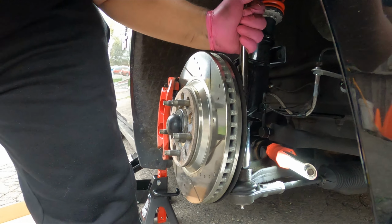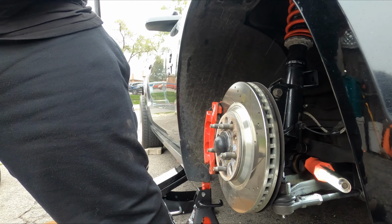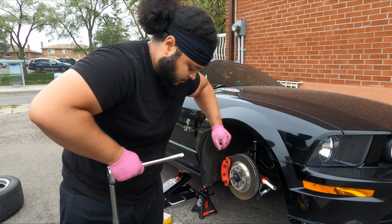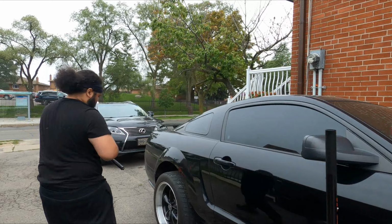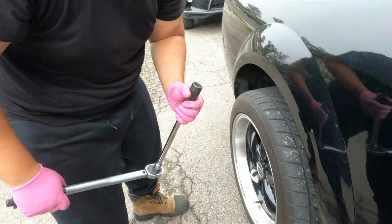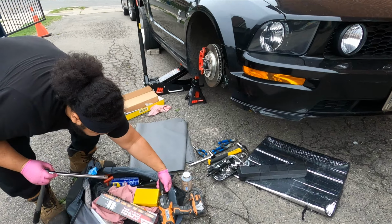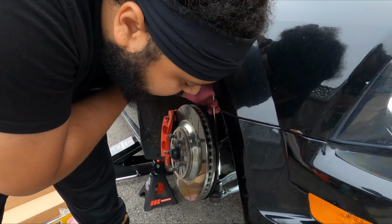This seems like it's not actually torquing it, but rather just continuing to go. I wonder if there's a way I could test it. There is a way I could test it. So sometimes what you gotta do, just, okay, so it does click as intended. Those are torqued to 100 foot-pounds, so if it didn't click, this thing would definitely be way off its rocker. But seeing that it clicks, it means we keep going. As tight as this castle nut feels like it is already.